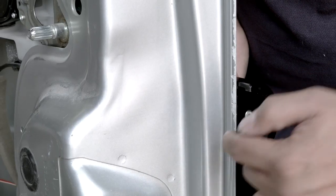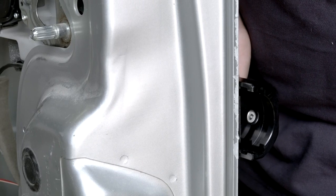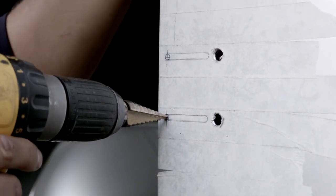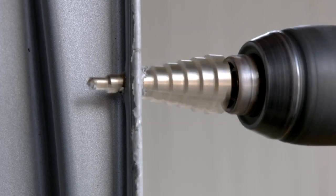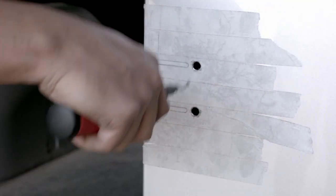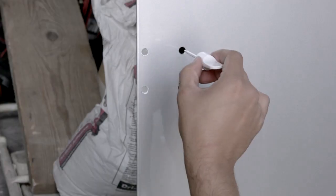We can check these positions now by using the underside of the lock body for guidance. Before drilling holes in the opening door leaf, we will ensure the fixed leaf is open to avoid accidental damage. Using the step cutter again, we will drill both holes ensuring that we do not exceed 8 millimetres in diameter for each one. We will clean the holes of filings and debris using the deburring tool and address the bare metal with the automotive touch-up paint stick again.